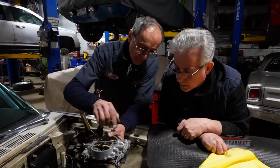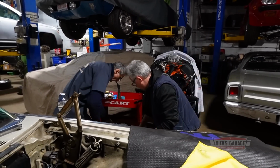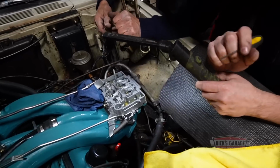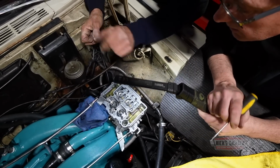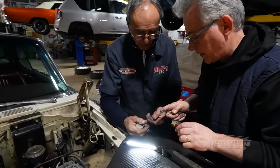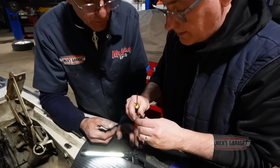There. Okay. You know what? You got a screw? Yeah, got it. Bring the light over. Let's take a look. You see the channel there? It's got fuel there. Yeah. So there's no issue with fueling. No. Now let's go back to that spring we're talking about. All right. Show me the other one, the weaker one. Here, there's the weaker one. Yeah. This is a lot weaker?